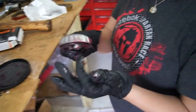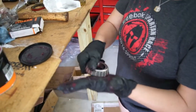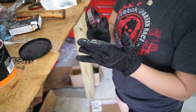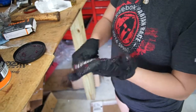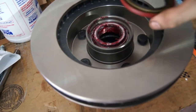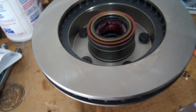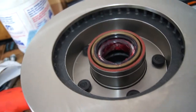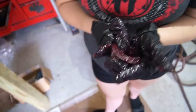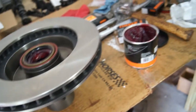Carol Lee is packing the inner wheel bearings. I'm going to get the rotor out so I can get the seal ready and put the bearing in. The wheel bearing is in. Now I'm going to take my seal and drive it in. The seal is in. Carol Lee is working on the outer bearing now, and we're going to get this rotor installed on the spindle next.